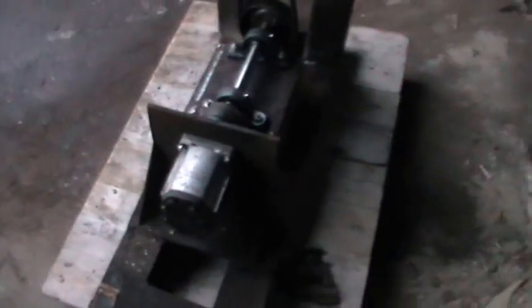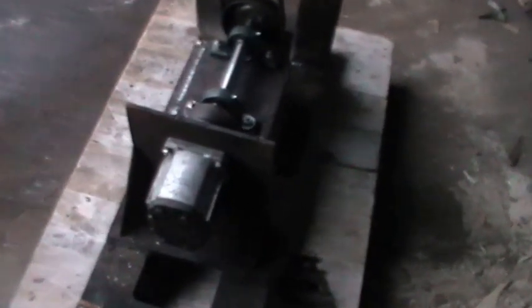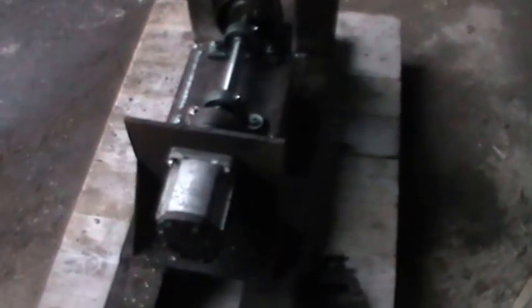I've got a big hydraulic pump over here that I use for running my wood splitter — it's got a 15 horsepower motor on it, so should have plenty of power. I should be able to run this at various speeds. The idea is we're just going to put a bypass pipe between the flow and return with a needle valve in it, so you open the valve up more, it bypasses more oil and slows the motor down. In theory, that gives an infinitely variable speed.